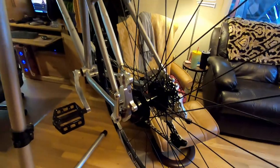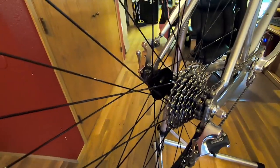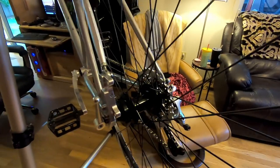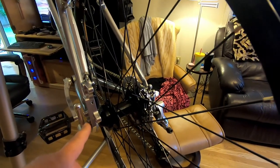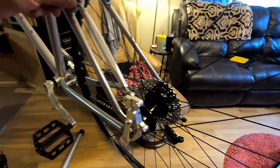In the Bridgestone's case, I was able to utilize the two lugs for accessory mounts — fenders, panniers, those kinds of things. That's how I've attached the actual bracket to the dropout. Really the structural integrity of the bracket comes from the skewer holding it all together; this is just a bonus that adds a little strength, plus it means that when you take the wheel off, the caliper bracket just stays put — you're not fiddling with it.